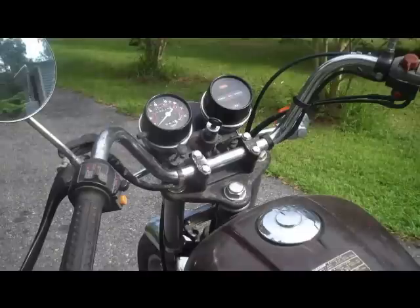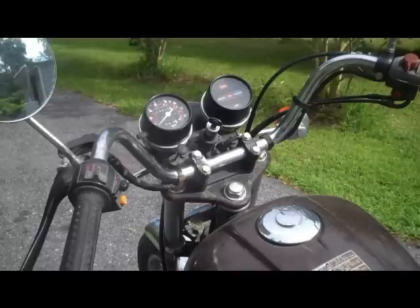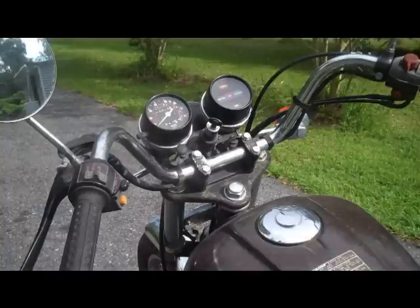That's a good way to start the bike if your battery went dead — if you left the lights on or something, or if your battery connections wiggled loose while you're out on the road. Alternatively, if you don't have a hill, you can get a couple of friends to push you, and once you get up speed, just pop the clutch. That's how you can do it on a flat surface.